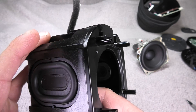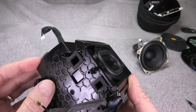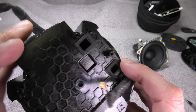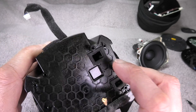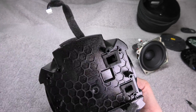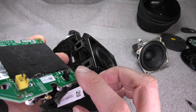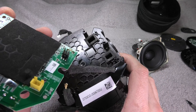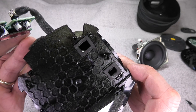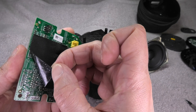There is a seal around where the driver sits, and on the top end there are two rubber seals. This entire component is designed to be airtight so the passive radiators can do their job. The yellow connector is for the driver, and the six pins go through the second hole — so as soon as you mount the motherboard onto the housing it becomes airtight.